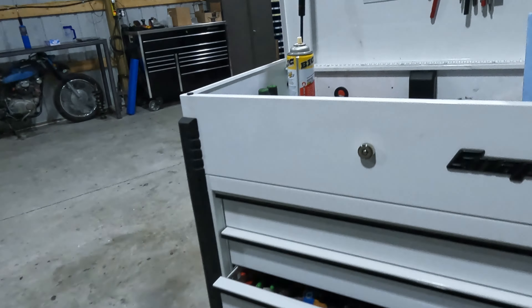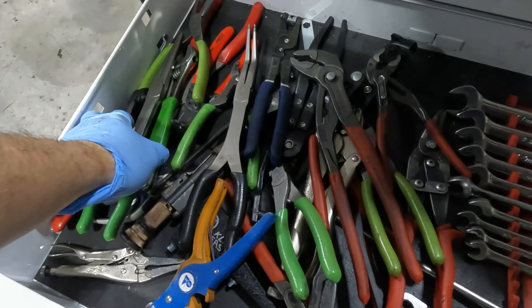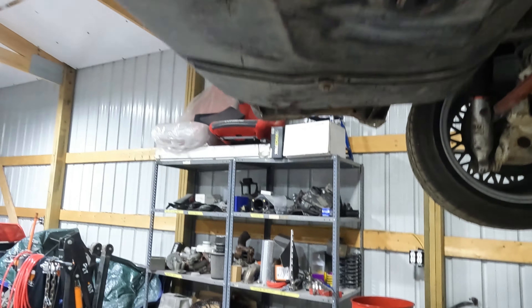All I have to do is cut these and then the fuel neck. Take a pair of these - might not fit in here. Cut, and cut. I need to add a little more reach. Perfect. Let's decide how we're going to go about this steel neck. I might just wing it - I don't want to unbolt it from here because then it might not seal again. If I drop the tank and go to the side a little it might just fall out, so we'll try that.